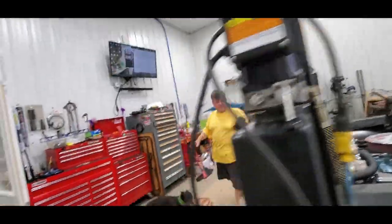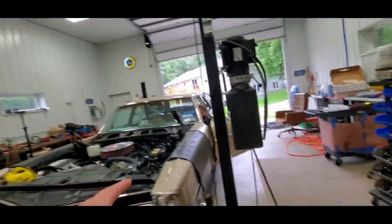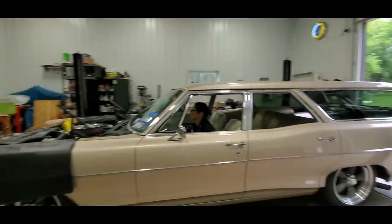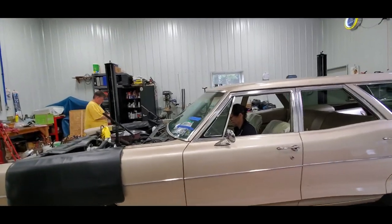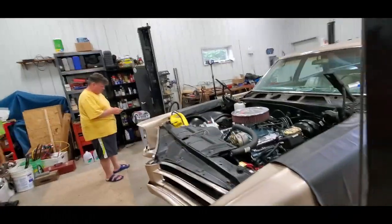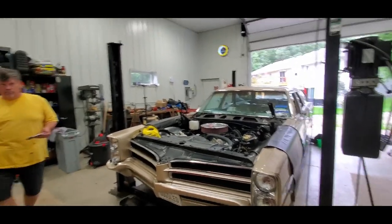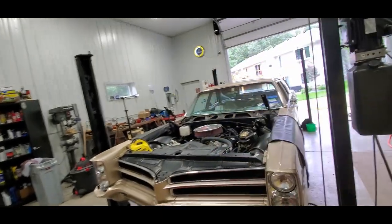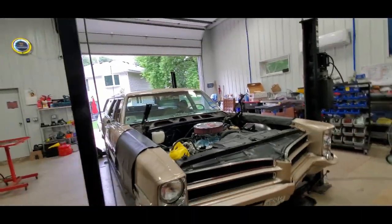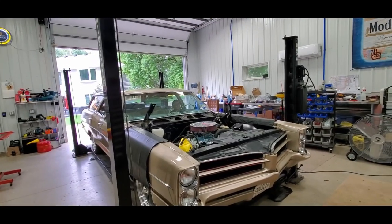We know that this is a long video, and ShopDog doesn't even care, but we have one more test we want to do. Cheryl's going to start the car. Diesel's going to set each corner to a given value. The car may not sit square because of different length lines, blah, blah, blah. And then in a couple days, we'll pull it up and see where they're at and see if any one of the corners decays faster than the others. So say they're all at 100 and the car sits wonky. And then in 3 days, he pulls it up and one corner's at 70, but the other three are at 90. That tells us something. If they're all at zero, that tells us something as well. Just another piece of data that we'd like to have.